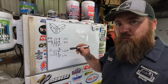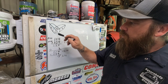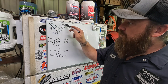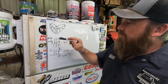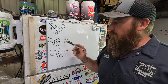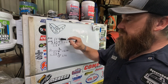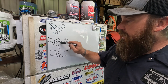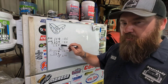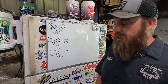Let me try to explain the LSA — lobe separation angle. This is a drawing of your camshaft. You've got your exhaust lobe and your intake lobe. Your LSA is the angle from imaginary lines from the center of your exhaust max lift to the center of your intake max lift. This camshaft is actually 114 degrees. But on the cam card it doesn't say that — you have to do the math. It shows the exhaust is at max lift at 119 degrees, and the intake centerline is at 109. You add those together — 228 degrees total. We're just averaging those two numbers, so you divide by two and get 114. That's our lobe separation angle.